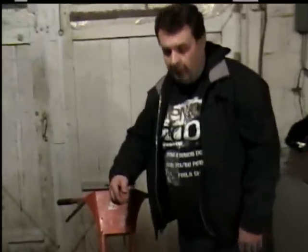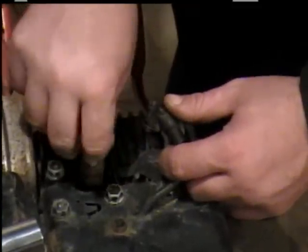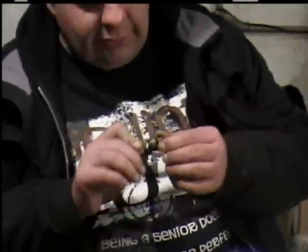Put the wire back on. Now I'm going to show you, before I hook the magneto coil back up, how to check your spark plug. First you get your proper size socket to remove it. Be careful not to break it — keep the socket straight, not angled to either side. You really need to use a socket designed specifically for spark plugs that has that rubber boot in there. Another thing I want to stress is the kill wire — if you don't put it back on and you start your motor, you won't have any way to kill your motor except by pulling the spark plug off. That can be dangerous, especially outside, because it will shock you with high voltage.